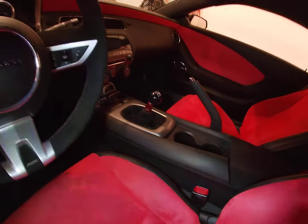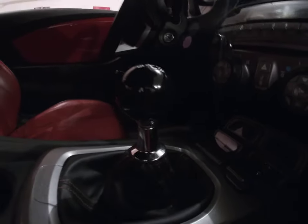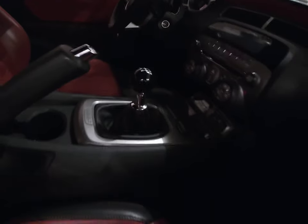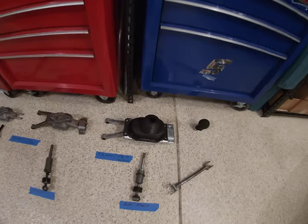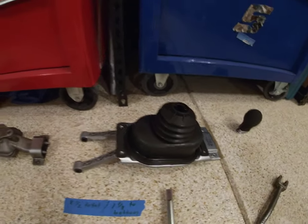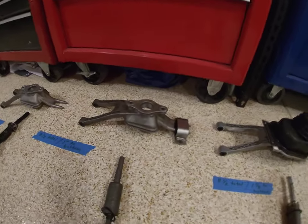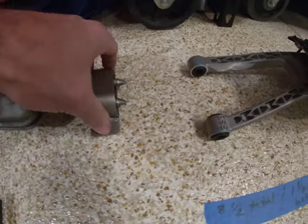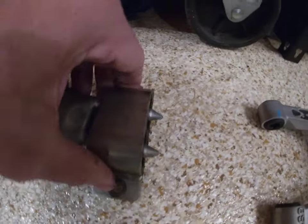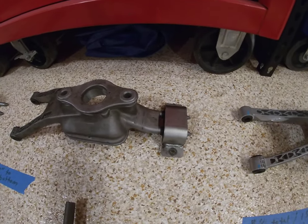I really like the flat stick but I also really like the retro — it just depends on what you're looking for. With the MGW, the whole housing assembly gets swapped out; you can see I've got three of them here from a couple of different cars and shifters. That's a good thing because with the MGW those rubber bushings go away — the squashy bushing in the back that just kind of moves around, especially under heavy load, goes away.